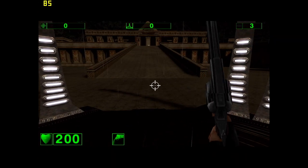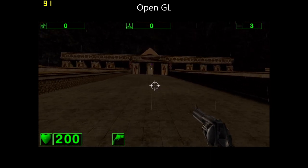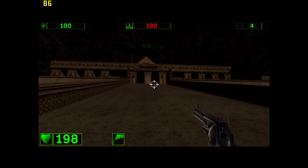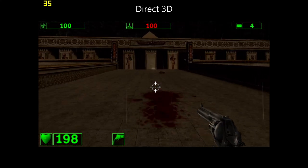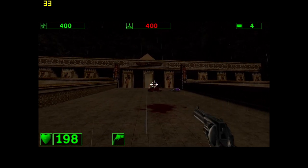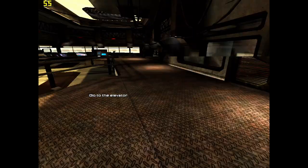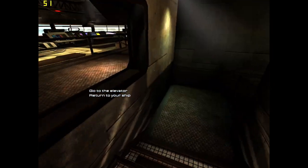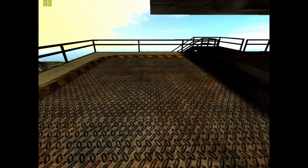Once the graphics drivers were installed, it was time to check out the performance on a couple of games we had already tested. As you can see, a dedicated GPU — even one as mediocre as the 2600 Pro — makes all the difference in the world. I was actually pretty impressed with the performance and also the sheer stability. It seems the CPU is really what is holding this system back right now. Hyperthreading doesn't register even when it's enabled, so it's only running on one core, and you can tell it's struggling. There are other options I may consider, and I definitely want to check this out more in depth later on.